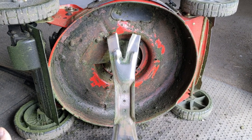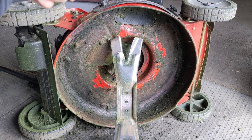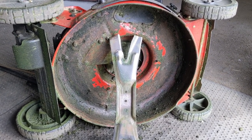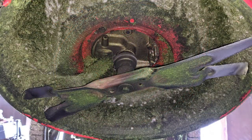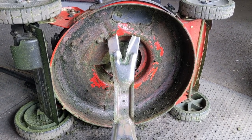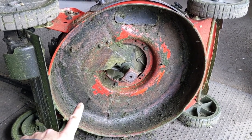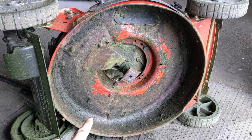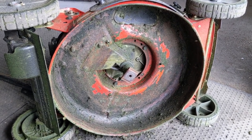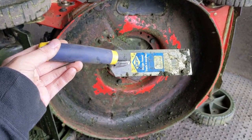What you're doing is cutting grass and the grass cannot go up into the blade to keep recirculating because it's already packed full of grass, so your mower is going to bog down. That's one of the things my customer had complained about, thinking it might be related to the carburetor, but in fact this thing fires up first pull and runs smooth. When I flipped the mower up and saw how much debris was under there, I said that was one of the contributing factors — the mower deck simply cannot cut the grass because there's not enough room underneath for the debris to go anywhere.